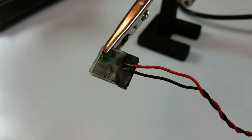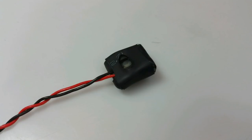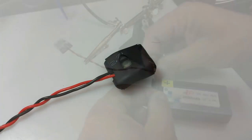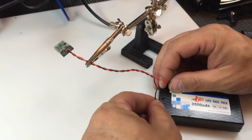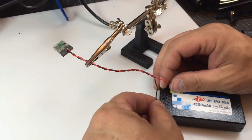I grabbed my iron, desoldered everything, stripped back some fresh wire, and soldered it on. Then I took a couple of big pieces of heat shrink, punched some holes in them, and heat shrunk two different layers onto the actual transponder itself. That way when I plug it in I can still see it blink. I've seen guys plasti-dip these which is probably even better. Later on I'll cut the shrink wrap off and 3D print my own little case to make it a bit cleaner.